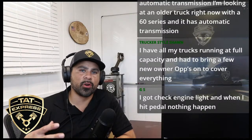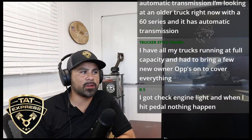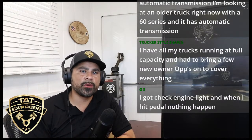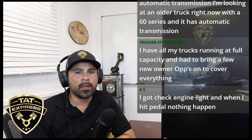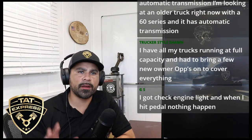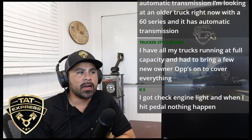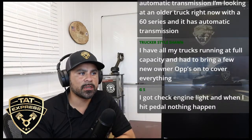Those are reserved for excessive pressure. So if you start seeing pressure going into that side of the coolant bottle, that's giving you an indication that something's going on. Also, if you see discoloration in that bottle, that's an indication that something's going on. Another thing you can look for, if you're buying a used truck at the dealer or wherever, and you see a brand new coolant bottle, all nice and clean, it's probably been changed for a reason. So you want to look further into that, I would suggest.